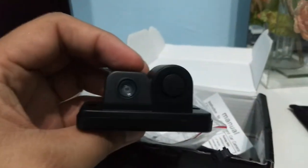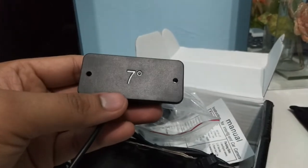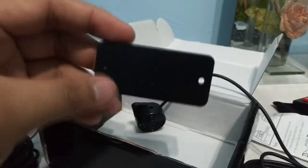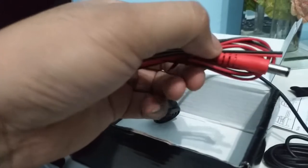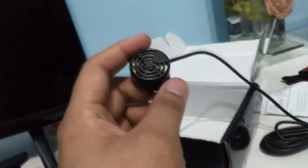The camera is here. Let me remove this plastic so you can see clearly. This is the camera on the left and the reverse sensor unit on the right. This is the mounting pad — it says seven degrees. There are a bunch of mounting pads here: five degree and three degree options. Depending on which car or situation your car needs, you can interchange this mount angle.